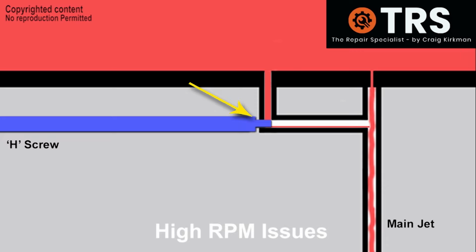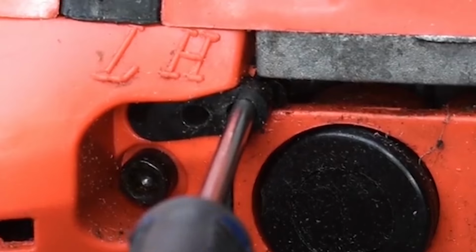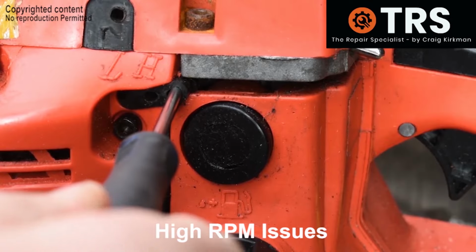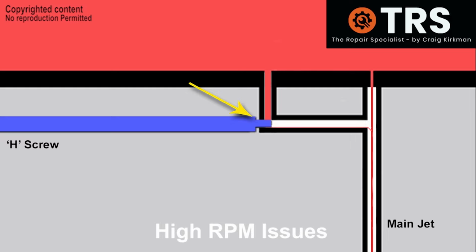And whilst this seems like the engine's got more power, it's usually considered as over-revving. And of course, if we continue to screw in and over-adjust, we're going to get this bogged down, because it's now blocking off way too much fuel. So the obvious remedy for this is to turn the screw anti-clockwise out to let more fuel down.